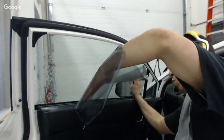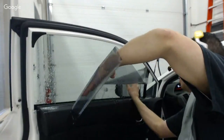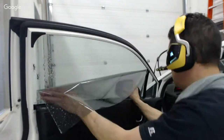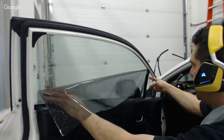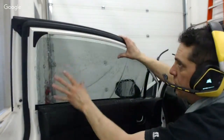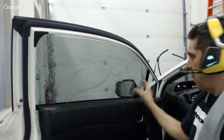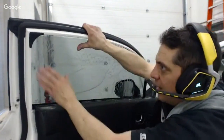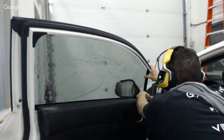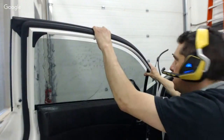And now I'm going to get this front corner in place. I'm going to work in the top front corner. I'm going to bunch a little bit. I'm going to get this bottom back piece in there. You notice up in the front here, I'm bunched a little bit in a safe manner, so I'm not going to crease. I am going to fold and bunch. It's hard to see, but the film's not smooth and flat. And I have to do that because it basically makes the piece smaller, right? It makes it so I can have an easy time getting this in there.